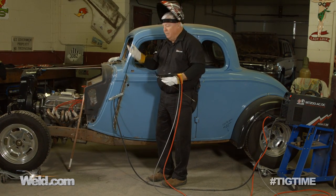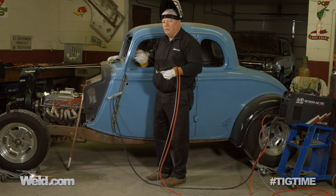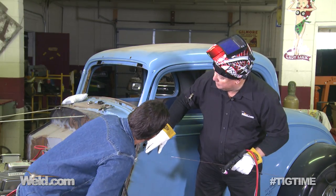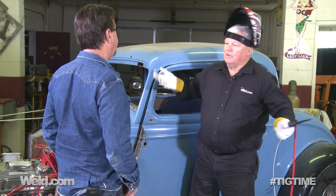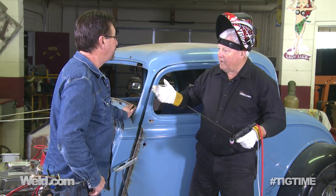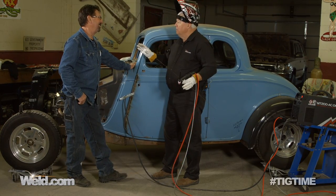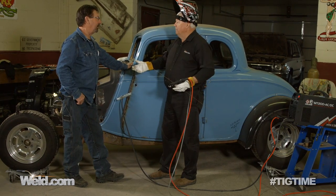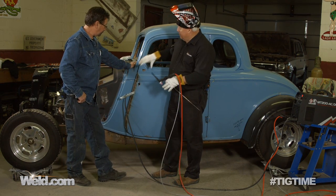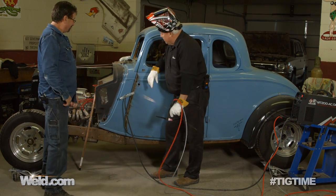So you can see I did a vertical-up weld and added a little bit of fill. We'll take this door off again — we're going to have to polish it and do all kinds of things three or four times before we get it perfect. Tommy, this is the first level of build up. You can put too much on, but you can always grind it off, so it's not a big deal. You just keep doing this cycle over and over, and you become the controlling factor — you look at it and say I need a little bit more or a little less. The reason I don't use MIG on this process is that MIG builds up so much that you have to grind it down — higher heat content. It takes more heat to do the same type of weld. So in this particular case I like using the TIG process. Looks good, Wyatt.